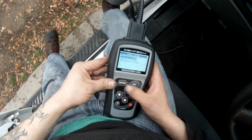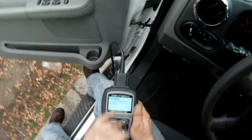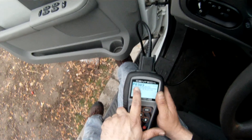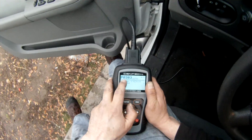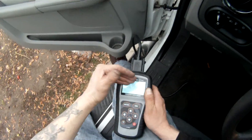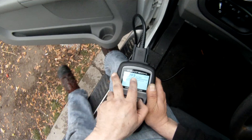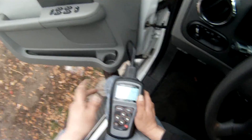Let's go ahead and read codes. Looking at the stored codes: P0303 — cylinder three misfire detected. Now that's interesting — if you're going to have a bad coil, this is the code you're probably going to get. P030X, where X is the specific cylinder number — P030 stands for a specific misfire, and the last digit tells you exactly which cylinder: P0304, P0302, P0301. So we have a significant misfire in cylinder number three — it is dead.